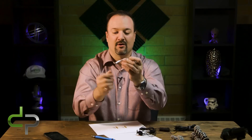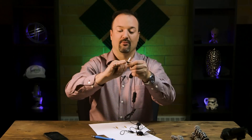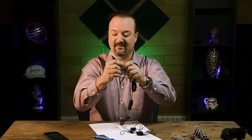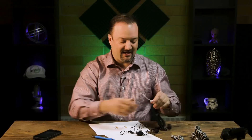A lot of the iPhones you purchase now will have a little cable to go to traditional headphones — lightning on one end and a standard jack on the other. What it is expecting for a microphone jack to work is a TRRS — tip, ring, ring, sleeve — so it's got three black lines on it. You would plug that in, it would go into your phone, and you'd be able to use it. If you don't have that, there are adapter cables you can purchase called a TRS to TRRS adapter, or vice versa.